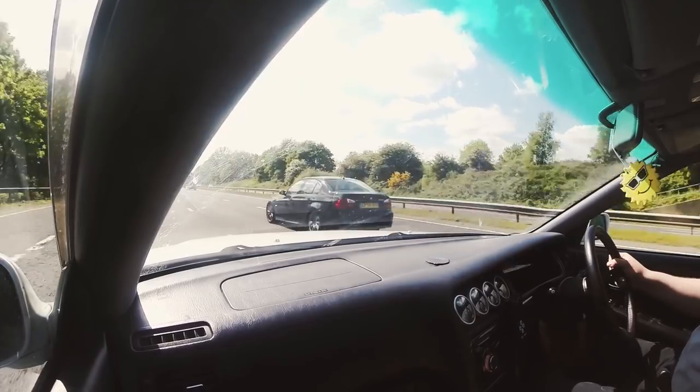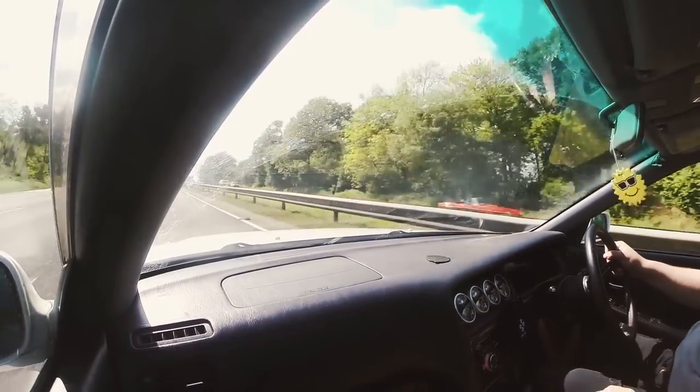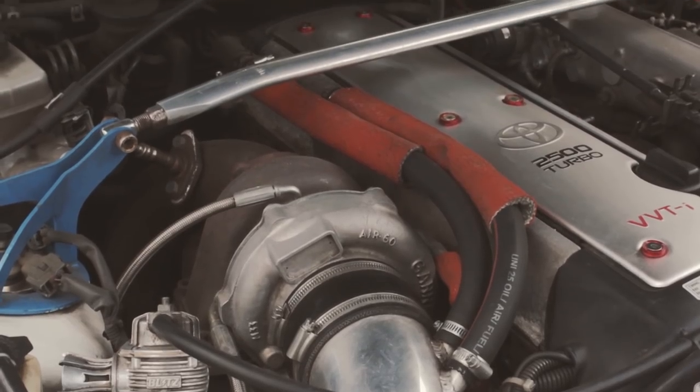Yeah, it's definitely 450 horsepower — Jesus. The BC coilovers are on 14kg/mm front and 12kg/mm rear spring rates, which is probably a bit soft. A lot of guys in Japan run them really soft at the back and quite heavy on the front. It's got a Walton Fabrication manifold and downpipes — custom-made, pretty good bit of kit. There's a Turbosmart 46mm external wastegate on it — screamer pipe, sounded a bit screamy.